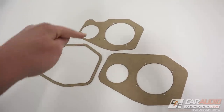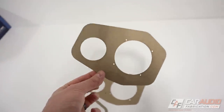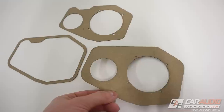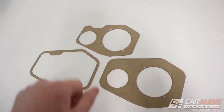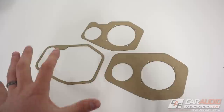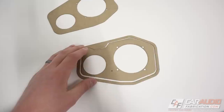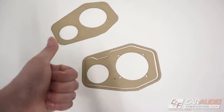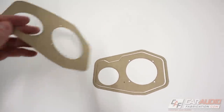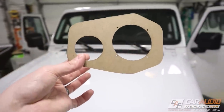I've got those three mock-up pieces off the laser, cut from chipboard — only one thirty-second of an inch thick, nice and thin, easy and quick to cut on the laser, and very inexpensive for testing before cutting from acrylic. I test-fit both the mid-range and the tweeter into these to confirm the mounting holes and bolt circles were all good to go — which they were. Now I want to take the main base piece over to the vehicle to test its fit.